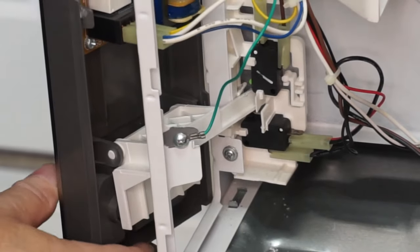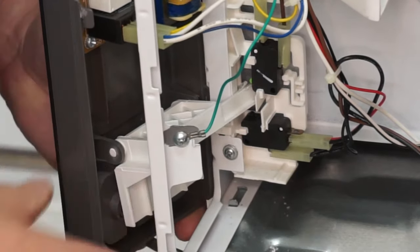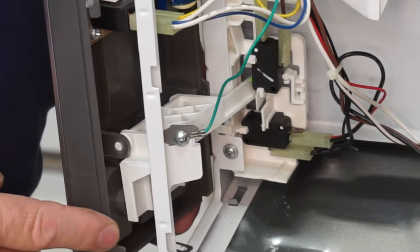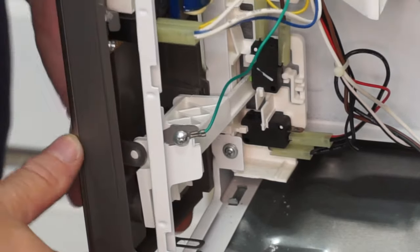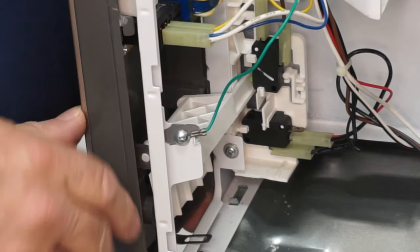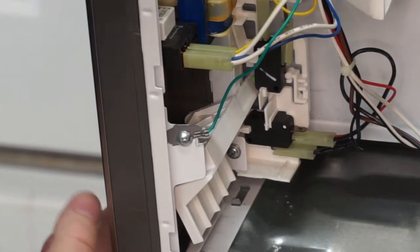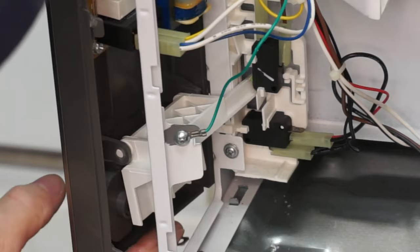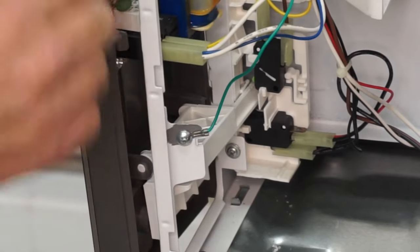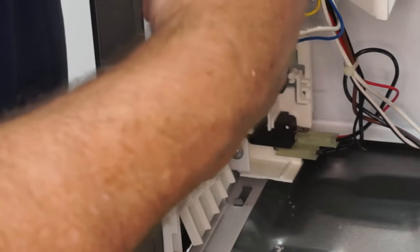This has got to be angled in. There are four tabs here — here's one right here on this piece, there's another one here, and you've got to get all those lined up. At the same time you've got to get this angled below the door latch lever. Then you put this in place and push it down. Make sure you didn't let your tab get inside the machine. Now it's in place. There's a tab right there and also an electronic connector. Make sure your wires are still connected good and solid.